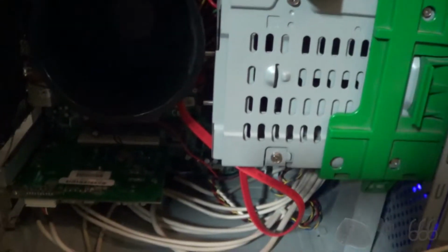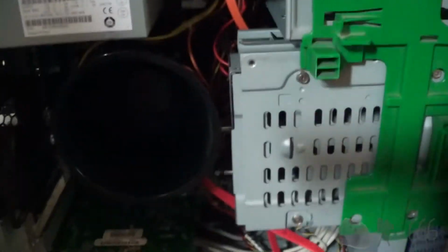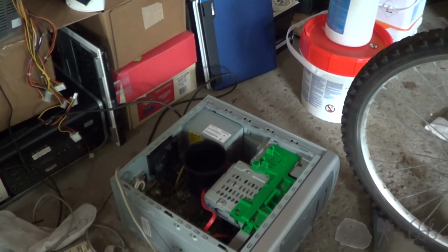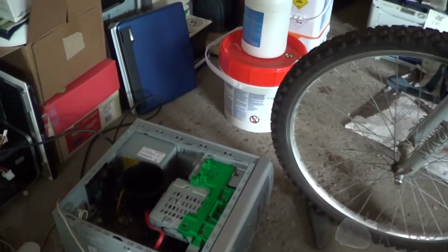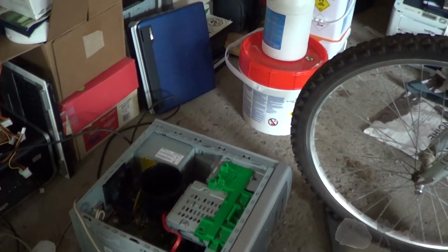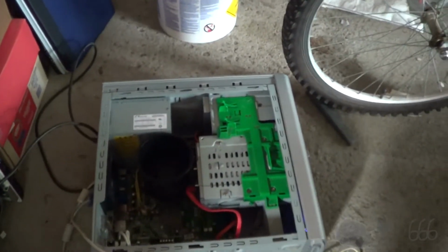I'm wondering if there is actually a memory issue, because I did touch the memory module. I noticed some graphical issues, so I wiggled the memory module and that's when it locked up. Well, I tried. Pulled the RAM out, changed it, changed the slot it was plugged into. Still doesn't want to post, so I don't know what's up with that. There's got to be some other issue somewhere. So, I think I'm going to pull some other components, but I'm going to do that later.